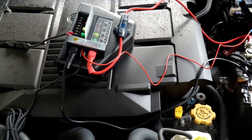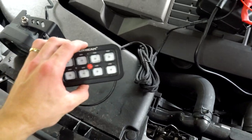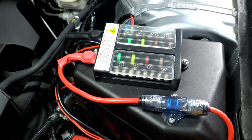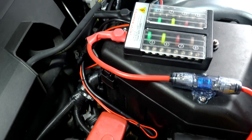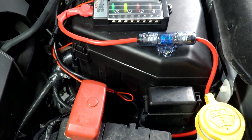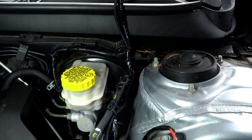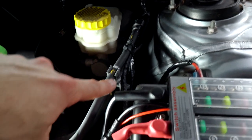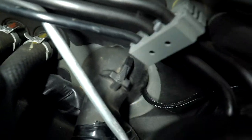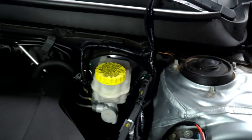We're going to put this all nicely under the hood and run this big wad of cable through the actual firewall so we can mount the switch inside the vehicle. We've got a 60-amp fuse and everything mounted on top of the fuse box, which looks really good so far. The cables are routed nicely with a little slack so you can still take off the lid. The braided wire runs back and down to a rubber grommet spot in the firewall, zip-tied into place, and goes through up to the switch.